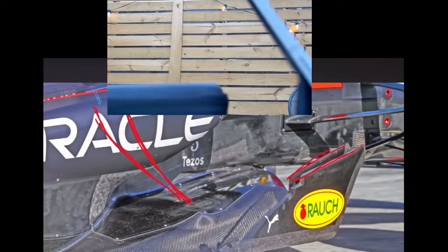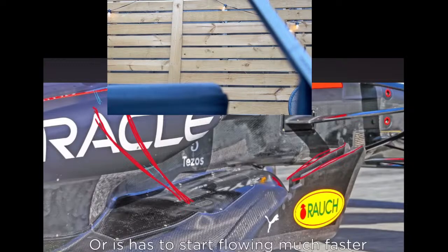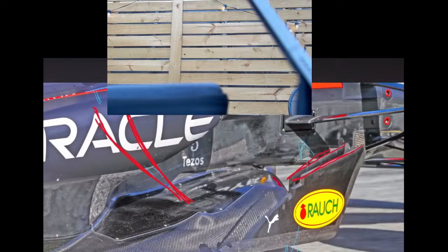Now, because this area has a certain inlet size and it's shrinking along here, the air needs to go somewhere. So we have to look at where the air is going in a three-dimensional sense. Basically, if this area is shrinking, the excess air has to pop out either the top or out the bottom. So what I'm thinking is that this layout is going to power up the vortex on the inboard most of these strakes. There's going to be a vortex running that way on the inboard most of the strakes. And then this jet of air down could either just go towards the ground, or maybe it is shedding a vortex that starts to spin in the opposite direction.